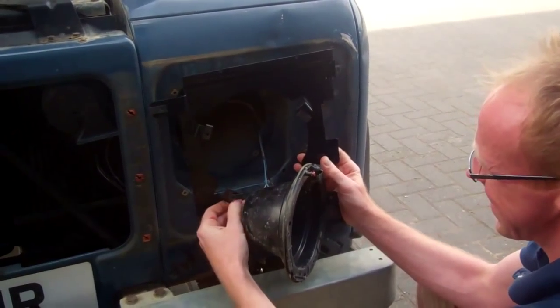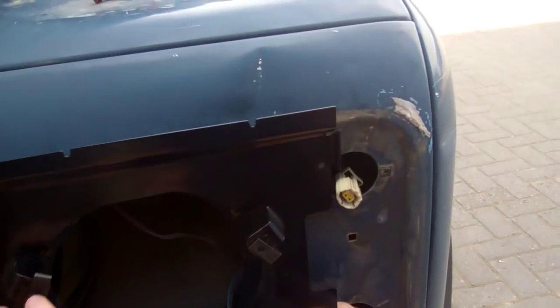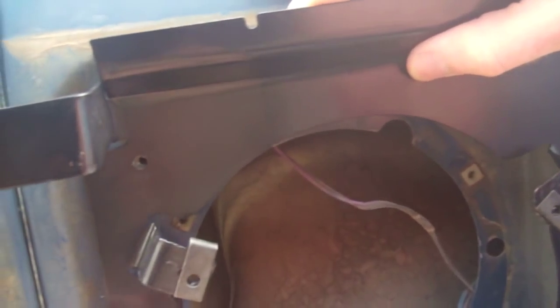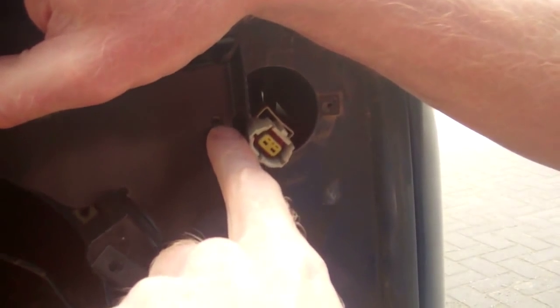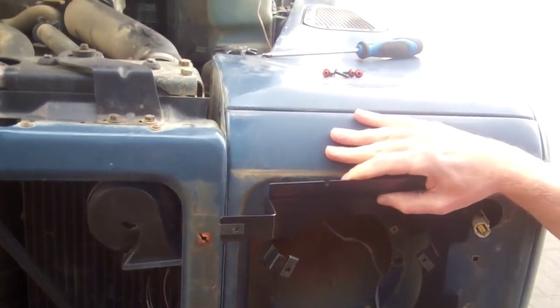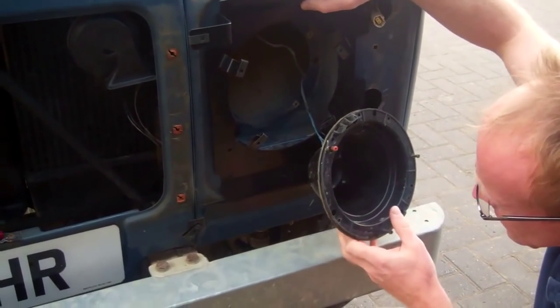Okay. And this is providing a spacer to space the headlight mount further out from the car. Now, what are we lining up on? So we're lining up on the original two screws there, and then we're picking up on the side light screw, isn't it? And then the indicator screw, and that one down there. Now, Tom, do they provide in the kit an extra two bolts, some riv nuts, to go here? Thank you.